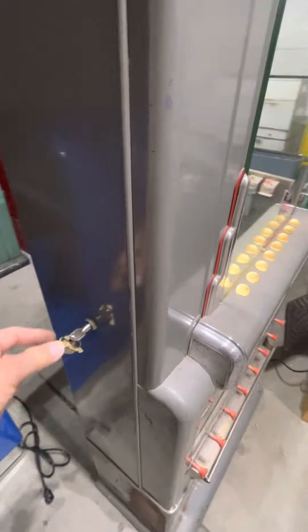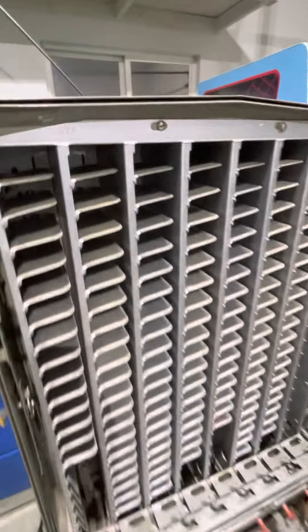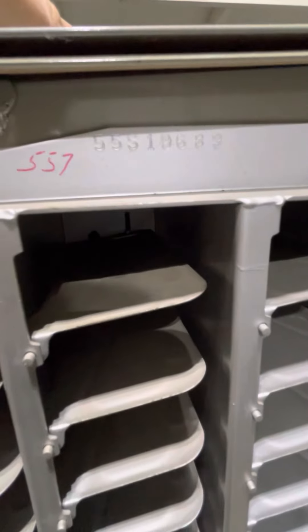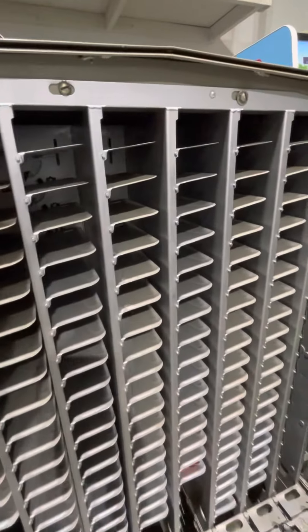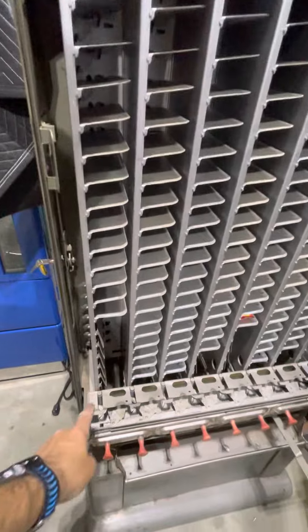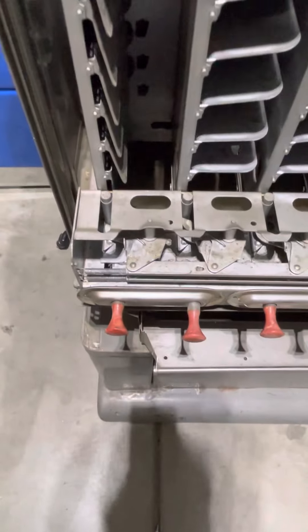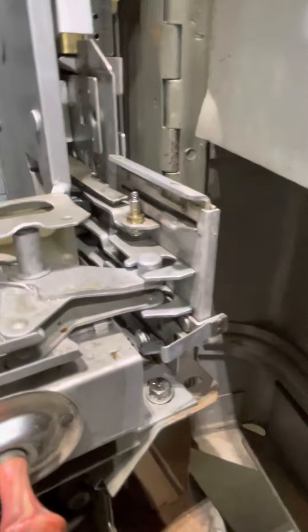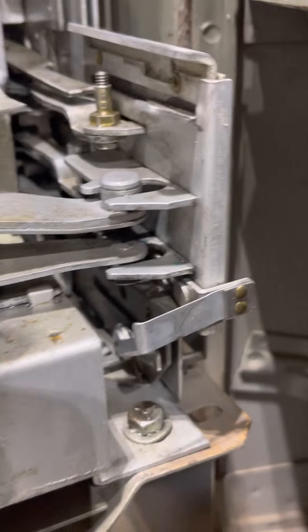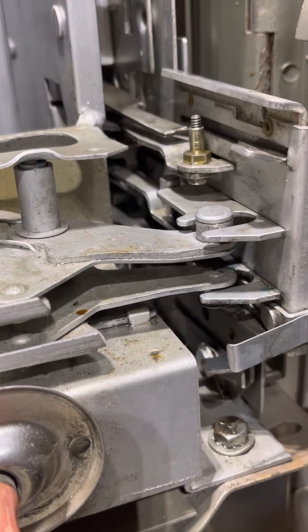From the side you've got your lock here which opens the storage compartment door, and then this is the inside of the machine. When looking at Stoner machines, the top will tell you the year with the first two numbers — this is a 55 model. The coin mechanism is stamped the same way. You've got eight columns with price bars down here, and when you adjust these price bars it changes the amount of money required by activating the pricing bars for the coin mechanism.